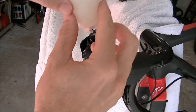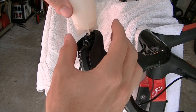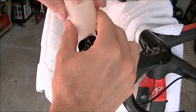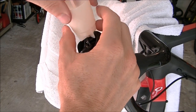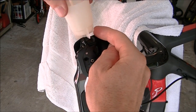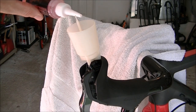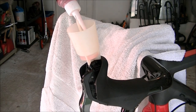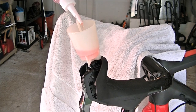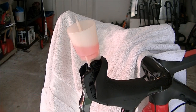Now I'm going to attach the funnel. These funnels have a little plunger so that you can put fluid in and it doesn't come out until you're ready. Just screw the funnel in — it doesn't thread in very far, so sometimes it takes getting it perfectly lined up, and you may have to hold that rubber cover back. Once the funnel is in, fill it about halfway with brake fluid. Any fluid you don't use, you can put back in the bottle when you're done.